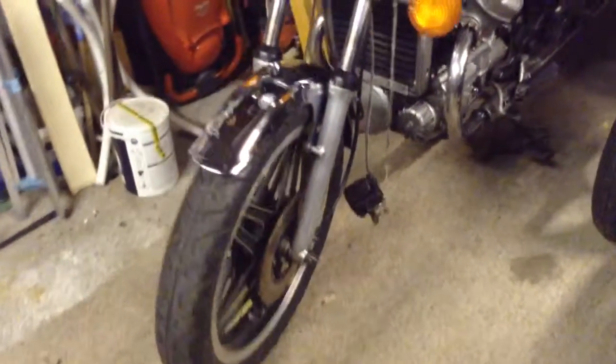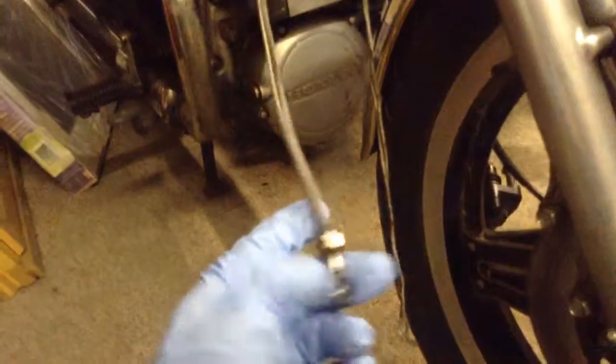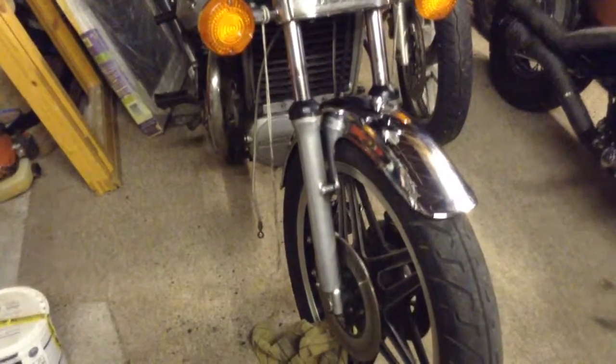The reason I've only taken the right-side one off is because it's a lot easier to get it off. You can see the hose coming down here with its banjo end, which is just sort of hanging free. I'm going to replace both that hose on the right and the one on the left, all the way up to the banjo unit there that both cables go into, and then they follow a single pipe going up to the master cylinder.